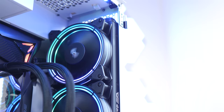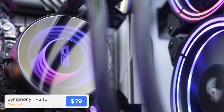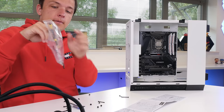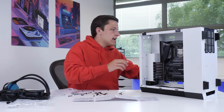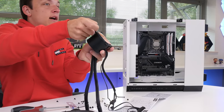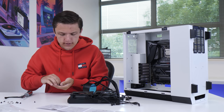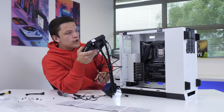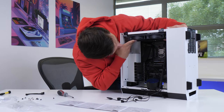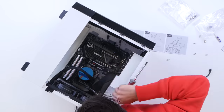With our case just off to the side for now, I'm going to grab our CPU cooler. This is from Dark Flash, and it's their Symphony TR40 — a really great value 240mm all-in-one liquid cooler which also has a mirrored effect on the block. Grab the Intel bag and take the pre-configured backplate, pop this through the back of the motherboard, then screw the two brackets onto the sides of our CPU water block. With that done, pop the pre-included fans on the bottom of the radiator and install them using the long screws. Then screw our radiator to the back of the case before securing the water block down into place.